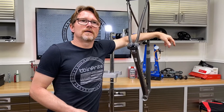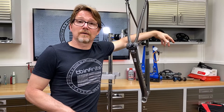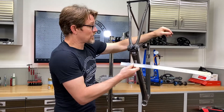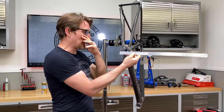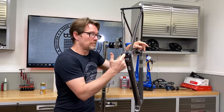BB30A is just like BB30 or any BB30 derivation in that it is 42 millimeters in diameter. Of course they can vary wildly in width, so what we have here is a bottom bracket that is 73 millimeters wide, just like a mountain bike — so a BB30 mountain bike would be 42 by 73.